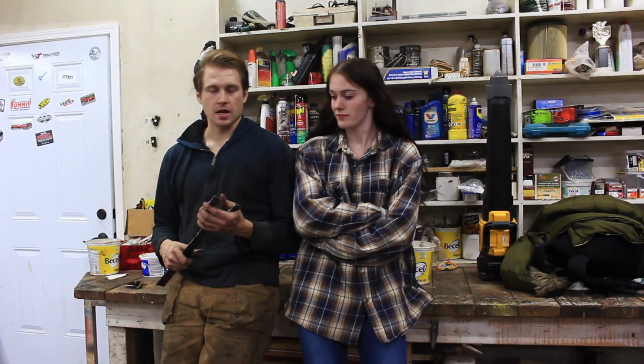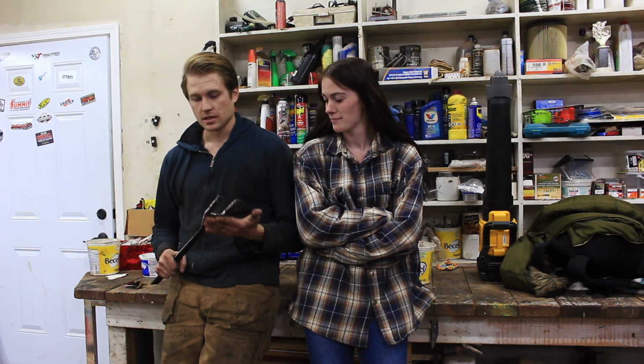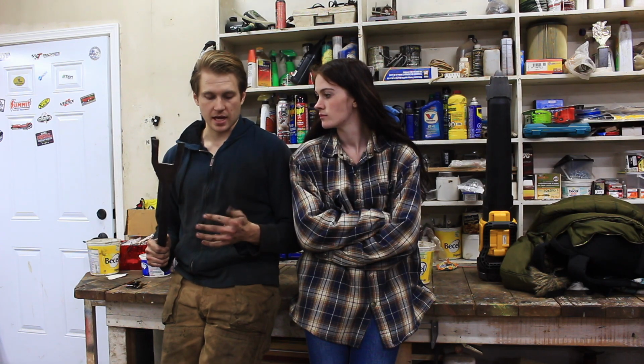Okay, so that was the video today, changing the front main. It did take us a little longer just due to some issues getting things off, some tool issues. I did expect to make this thing going in, just didn't give myself enough time. It's really not a hard job, you just have to have the right tools. The most important tool is going to be the harmonic balancer puller, as well as whichever way you plan to get the fan off, but it's a pretty simple job other than that.